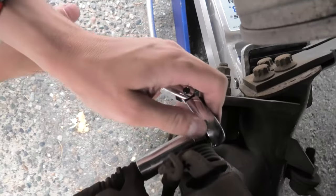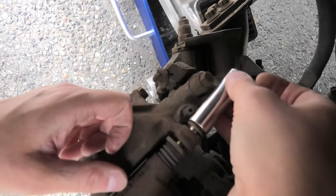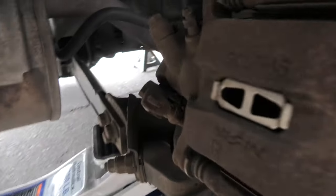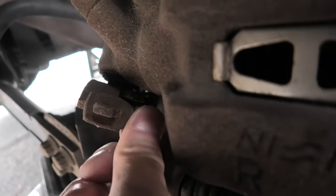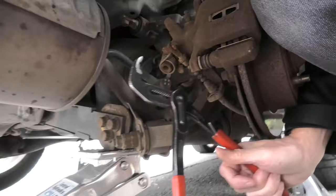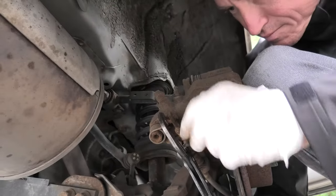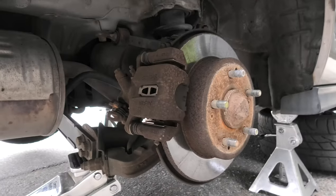The effort is actually not huge. This is how the bolt looks like. Also don't forget to remove the parking brake cable. If it's not loose enough to remove by hand, you may need to use pliers to release the spring. Then you should be able to remove it by hand. And now we will remove the caliper — you can use a screwdriver to pry it.